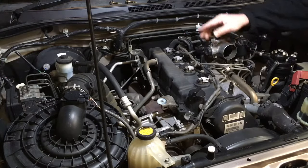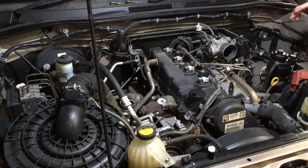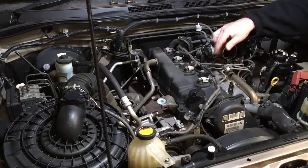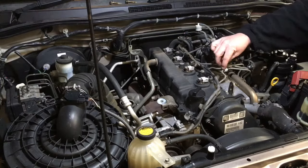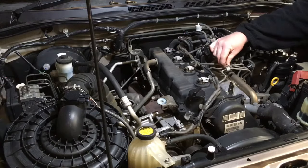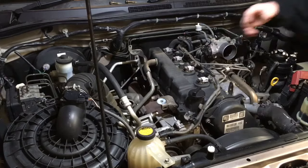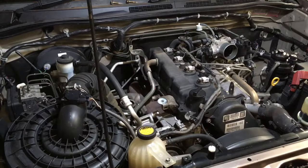Okay, so over time, when you service the vehicle, there are a couple of clamps around, a bit different on the 120s and the later Hiluxes. There's two clamps up here, different fuel lines, like I said. You need to make sure they're tight and not moving, because what can happen is it can come to the end here and the metal can rub and rub through the pipe. Luckily, it's all good here on this one, but it could have got worse. So that's the intercooler off.